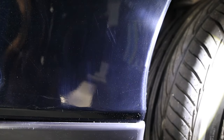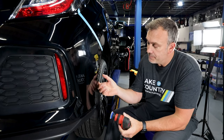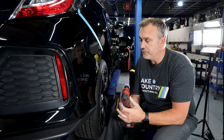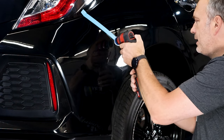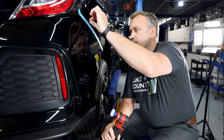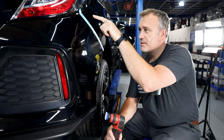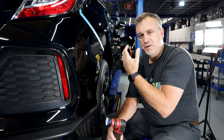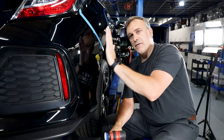It's a massive improvement. Now that we can see it's worked here, I'm going to stick with the microfibre one inch pad along here. Make sure you get all these little tight areas finished first, running up and down - probably two passes on some of these. I can see some deeper marks so I might need two passes, but I'm going to inspect after one pass, alcohol wipe it, check it with the light, then I'll go to the middle.